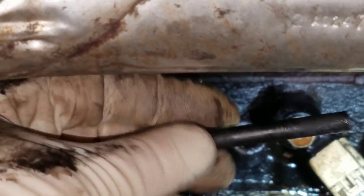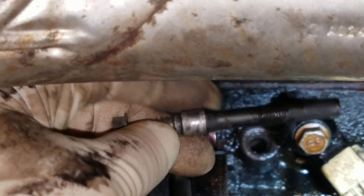Alright, so I was able to get a screw into the rest of that portion and get it loose — I had to work it back and forth for quite a while. What I actually had to do was turn this with a 10mm while someone went underneath and was tapping from the bottom side, and we were able to get the rest of this part out. Now, worst case scenario if you're not able to get it out, and if it falls in the oil pan, there's an oil screen under there and it's probably not going to go anywhere — but certainly not a good idea to have that in the oil pan. If it does go in there you'd probably have to pull the oil pan off to get it out. But we were able to get it out with that self-tapping screw. Hope this video was helpful — if it was, hit the thumbs up and subscribe.